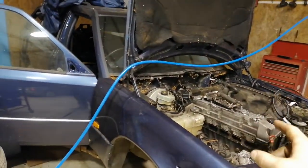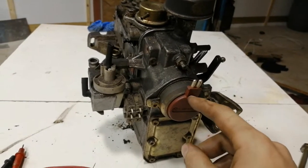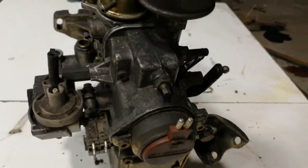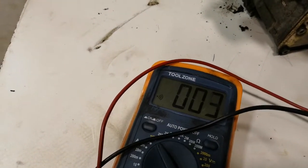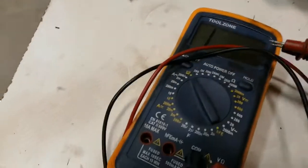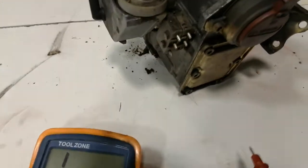On this one it's controlled by that very basic computer. I got a lot of advice on Facebook and the like, and seemingly you don't need it. I can tell it's an open circuit just sitting there — if I set this to continuity and touch both, you see it's an open circuit. Basically all you're doing to increase or decrease the idle is cause resistance in the circuit.